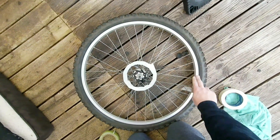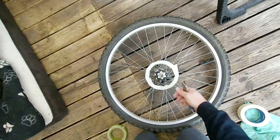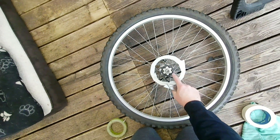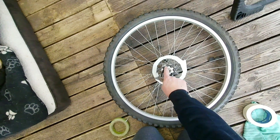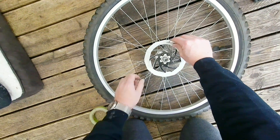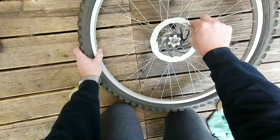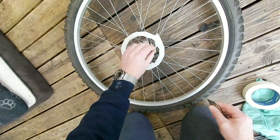What I've done here is I've gone ahead and sanded all the rim and the spokes, degreased it, decontaminated it so it's ready for taking paint. The rotor — with it being an old wheel — I don't really want to start trying to undo these bolts as I could round them off, so I'm going to leave them on. I'll probably replace this wheel for a new one in time. I've just gone ahead, taped up the rotor, and I'm going to trim back this masking tape so it's ready for paint.